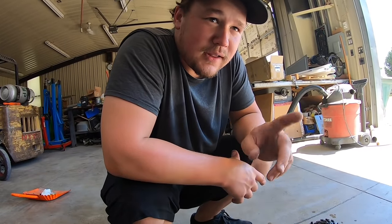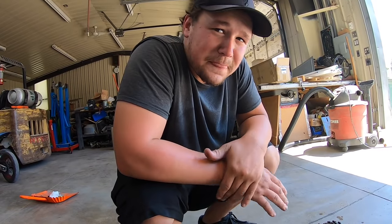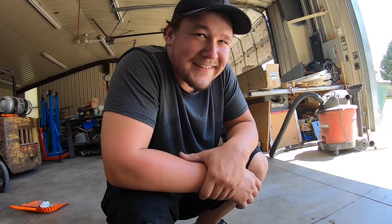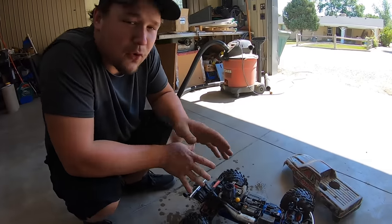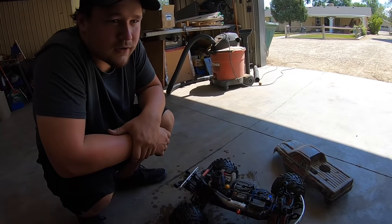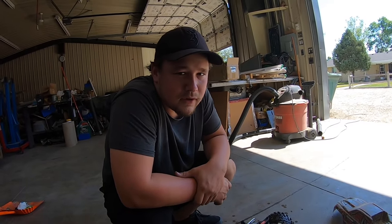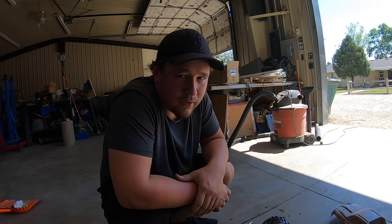Did you tell him how much it's going to cost me to build a Turbo 400 for the Duramax? Let's just say it's going to be double what you sold your Civic for. Between converter and transmission, he's looking at like 15K. I'm probably not going to go Turbo 400, as cool as that would be. It's expensive. I'm probably just going to go with a 48RE out of a Dodge because I can build those in-house all myself. They hold a lot of power without needing $15,000 worth of stuff. Plus, the part that's expensive on the Turbo 400s is all the lockup converter stuff.